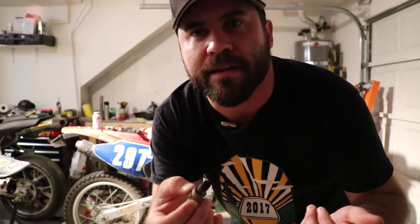Once you have the spark plug out, it's helpful to look at it and see what you can tell about the condition of the motor. This plug is basically fuel fouled — the motor has been running too rich, which I suspect was a result of me not really maintaining the bike before retuning the carburetor. This bike also has a jet kit, which may have something to do with it. Some other things to look out for are oil fouling, which could indicate bad valve guides or a bad ring seal. If you have mechanical damage to the plug, that's also something to look out for. If the plug is white or very light brown, you may be running a little lean. There are plenty of videos out there about how to read your spark plugs, so go find one of them.